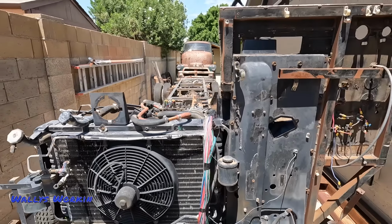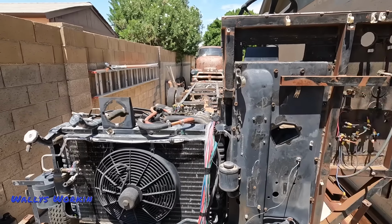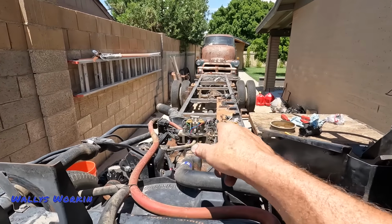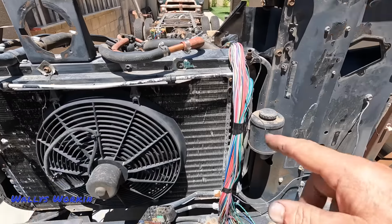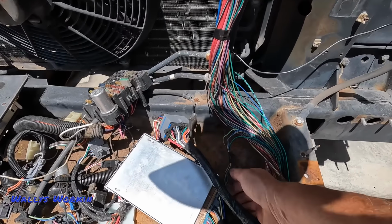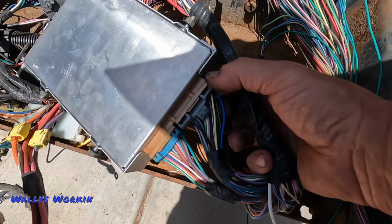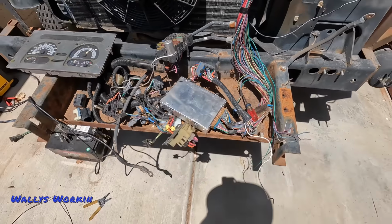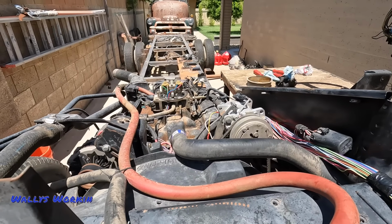So I figured it was something either with the injector or it was getting power or something. So I checked the wiring harness and looked some stuff up online on which one is which. Then I basically just traced all that stuff and checked everything out. And then that blue wire that goes to that injector was over here. This plug wasn't completely seated all the way. So I snapped it back in and that seems to have fixed my problem. All right, so now.